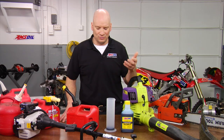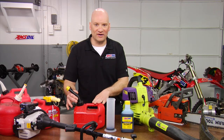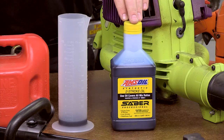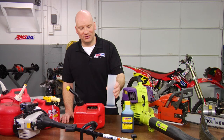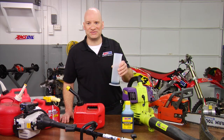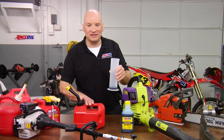For reference, when we talk about mix ratios we're talking about different amounts of oil and different amounts of gasoline, so let's stick to one gallon of gas for reference. AMSOIL Sabre Professional is capable of providing protection all the way down to 100 to 1. What is 100 to 1? It's 1.3 ounces of oil for one gallon of gasoline — that's all you need.